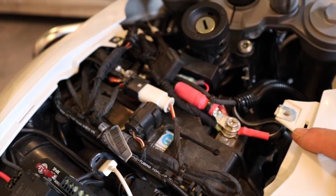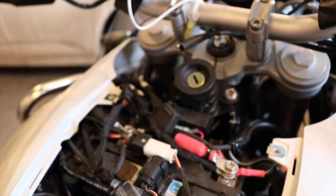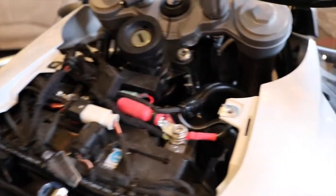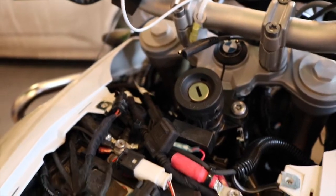I ended up having three inline fuses directly on the battery — one inline fuse there and two more labeled right here. One of the ports is a two-pin for my tank bag, but I could also use it for the air compressor since it's directly in line with the battery. I've got my winch directly connected to the battery as well. I also have another two-pin connection nicely tucked away beside the bike for the air compressor, and I can also trickle charge my battery from that port.